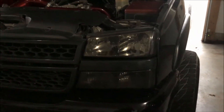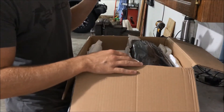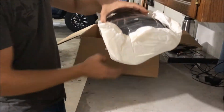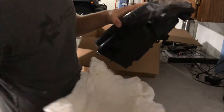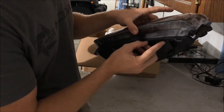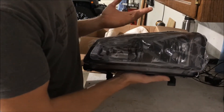I'm going to paint the housings on these black as well, so it ought to be pretty clean, pretty bright, but hopefully still halfway incognito. I'm not going to do any of the RGB halos around the outsides or anything like that — I just want it to be super clean, as stock as I can make it, but make it look pretty sweet. I would recommend getting aftermarket headlights because they use a butyl rubber glue around the outsides versus a permaseal like the OEM one does. That one's almost impossible to get off.